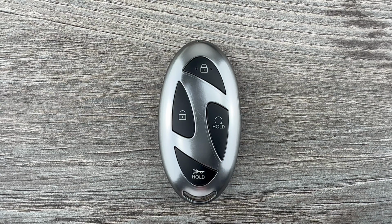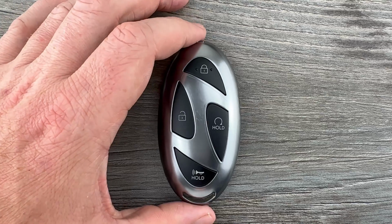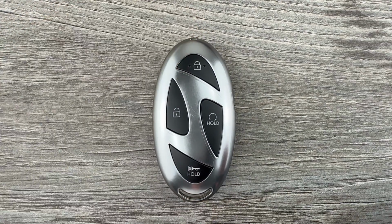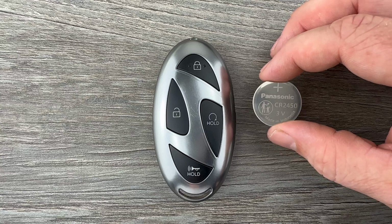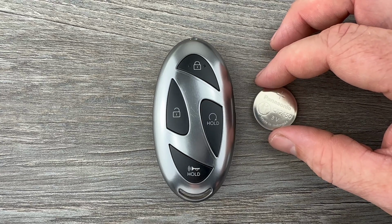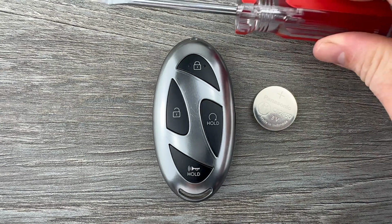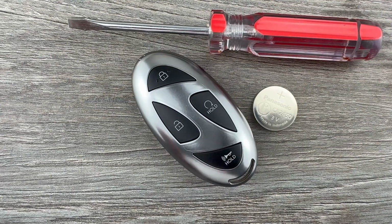Today we're going to take a look at how to replace the battery in this Hyundai Sonata remote key fob. This Hyundai Sonata key fob is going to use replacement battery CR2450, and I'll put a link in the description box of this video to where you can find these batteries if you're in need. The other thing I'm going to be using to change this key fob battery is a flathead screwdriver.